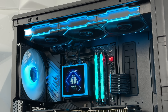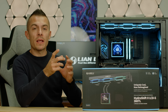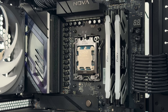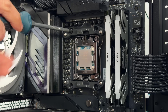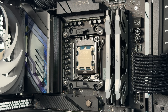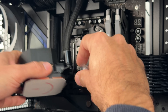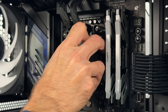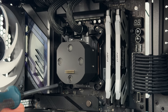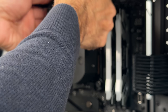The mounting mechanism is straightforward, the same as on the LCD C. You remove the original retention brackets from the AMD motherboard and place their retention brackets instead. Note that the pump block needs to slide from right to left — the brackets in the accessory box have arrows indicating the correct direction. You use four screws to mount the brackets, apply and spread thermal paste, slide the block right to left, then tighten four threaded thumb screws to secure the block to the processor. Then place the LCD screen on and you're done.